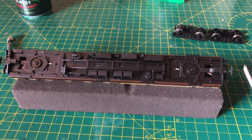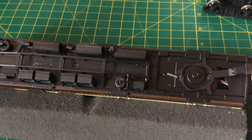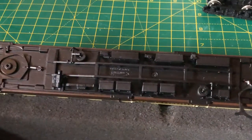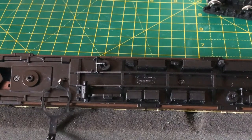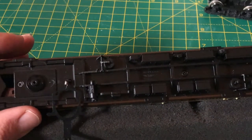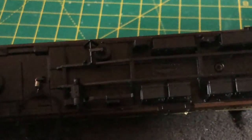Next, have a look at the chassis of the body. You'll see there's a centralised screw there. If I just pop the cradle over a little bit and move these out of the way — be careful that the little springs don't go shooting off — you'll see that exposes another screw on that side. And on the left-hand side of the picture there's another screw point there. So you want to remove those three screws. Apologies for the background noise — I'm right next to a main road.